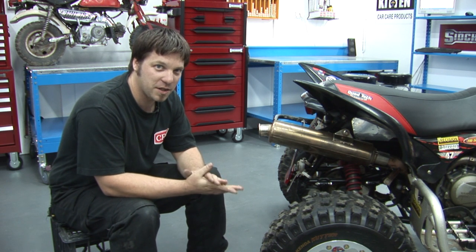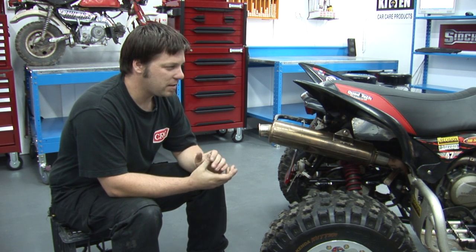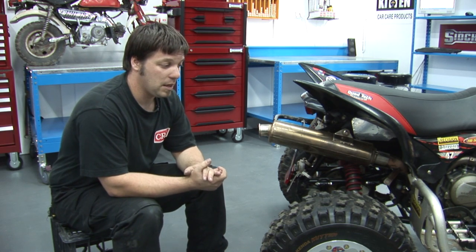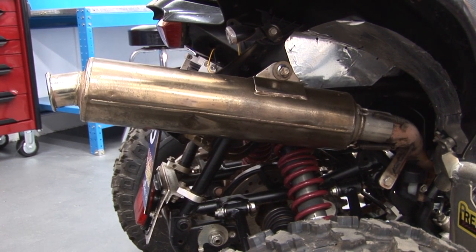You would think finding a pipe to use for this sort of bike would be easy. We've had a lot of trouble with alloy pipes over the years, especially at Safari. We had some bad experiences with some alloy exhausts on Renegades a few years ago. So we went to using Staintune pipes, which are a full stainless system. They don't have a tendency to rattle apart. So even though Staintune don't make a pipe for this model, we've got a hold of one and modified it to suit.